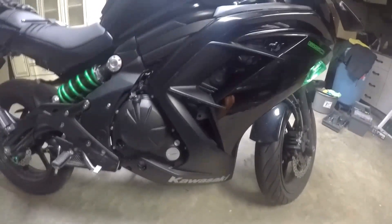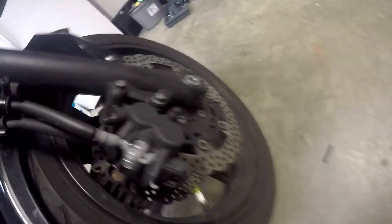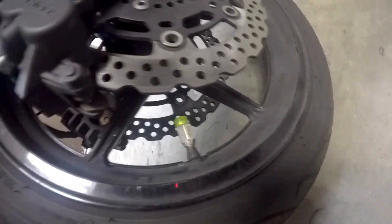Now the next thing I want to do is underneath here — if you've ever done an oil change, you know that there are three little plastic plugs. These three plugs need to come out. The first one's right in front here; you just get your flat head in a little notch there and it should pop open and pull right out. There are two more underneath. This one looks like it's half out already. Don't worry if you break these — these guys are a dime a dozen really.